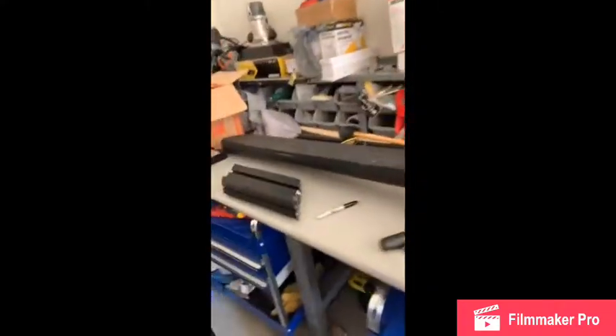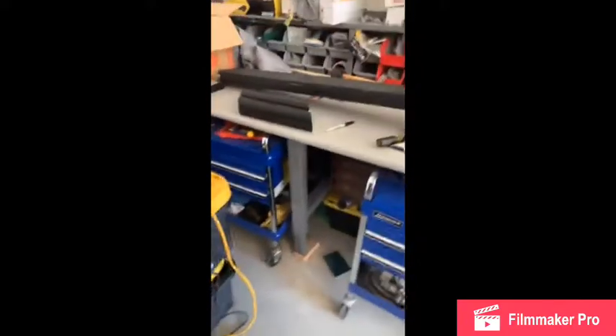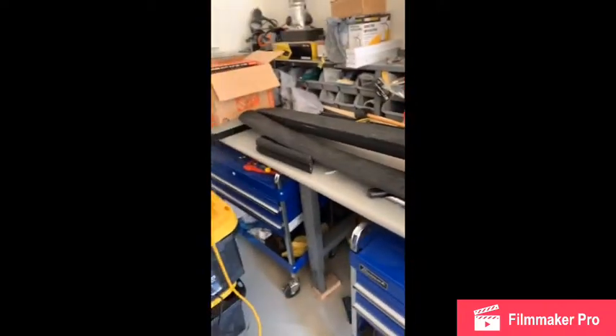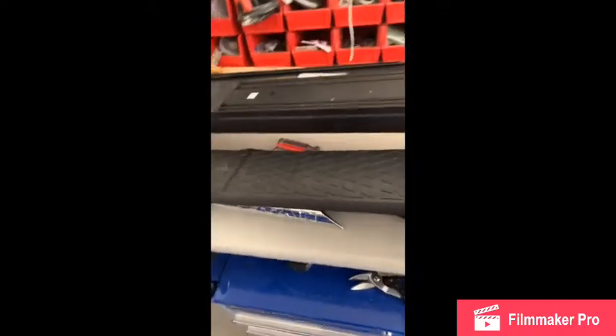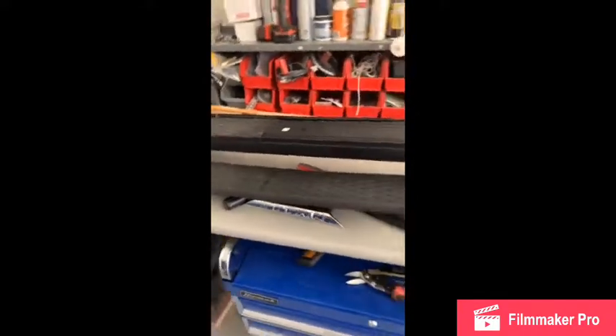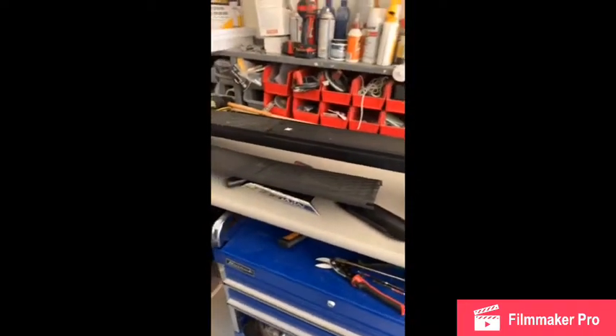This is the only way you can really get it cut. You don't cut the front part of the step — you cut the back half, because that's the extended part. What I did was cut back 13 and a half inches. Make sure you measure it. If you're not mechanically inclined, don't try to do it — just go buy the right steps.